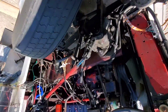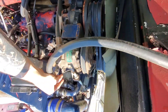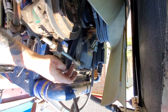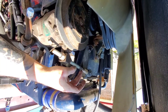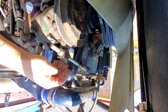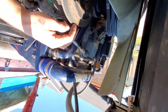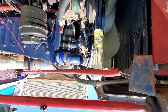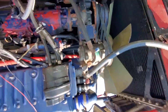I don't know if you remember, but my AC compressor was wobbling all over the place. So we went and got a heim joint, wallowed it out, and ran some all-thread up in there to where we can make an adjustment on it. Replaced all the belts, and I got the hydraulic line for my fan clutch — so it's working now.